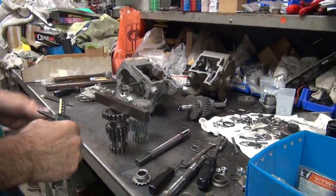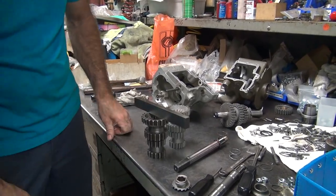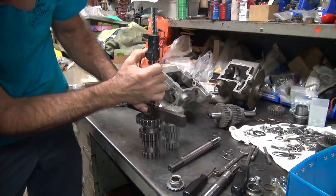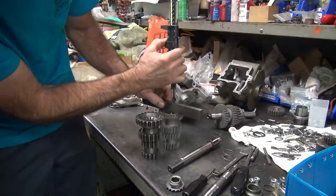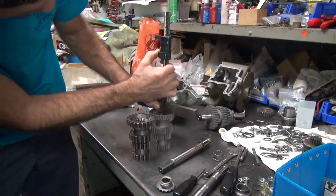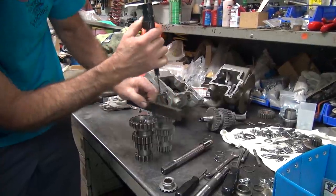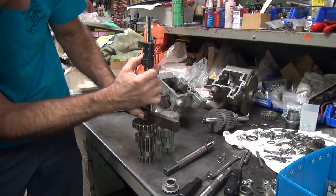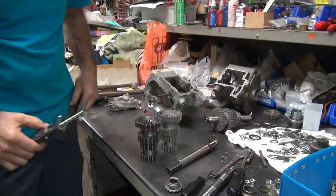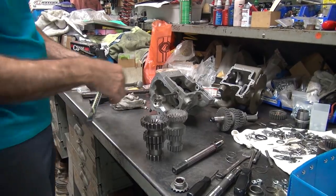So we're 48 thousandths too deep — and that makes a difference. Which one was too deep? Then we're going to have too much slop on those bearings. I'm at 8 — 18 that way. Yeah, 8. No, actually that one's deeper — 7.81. No, that ain't it. This one's actually deeper. So that's not it. This one's deeper than that one — so that's not the problem.